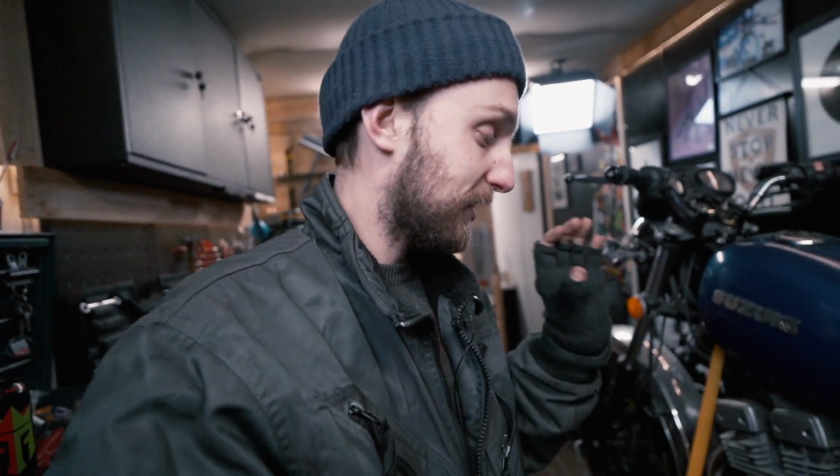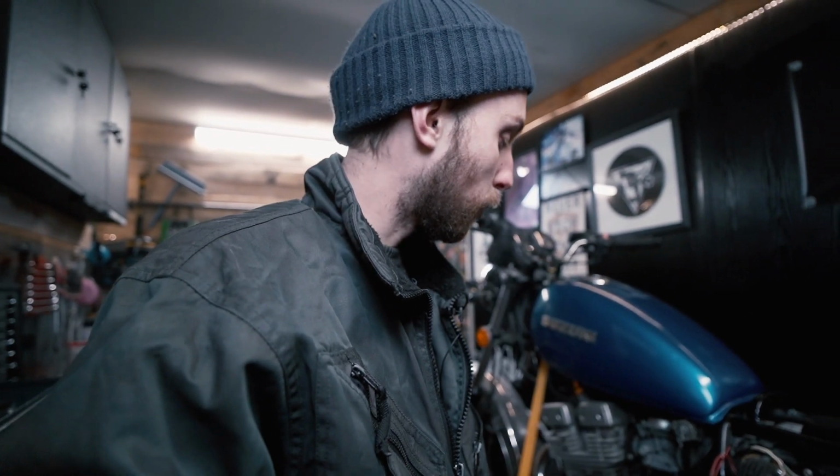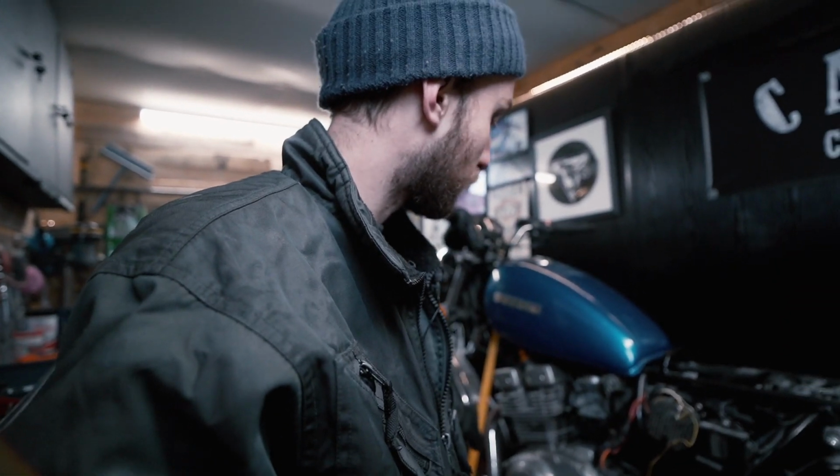So there we have it, it starts, and yes, it does sound very tappety, which does indicate to me the timing chain tensioner does actually need doing like I was told. So the starter solenoid, that's okay, we know what we're doing with that. I'm glad it started, I'm glad there's not a hell of a lot more that needs doing to it to get it in that running state. Next video we'll get this thing properly running, making sure it runs really nicely, even maybe take her a little spin around the yard, who knows. It's all good news.